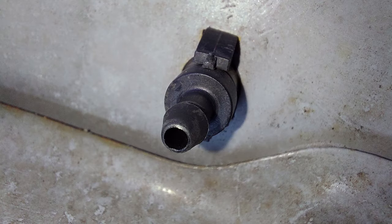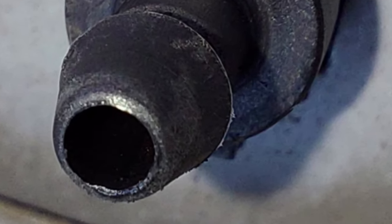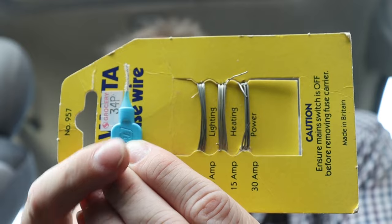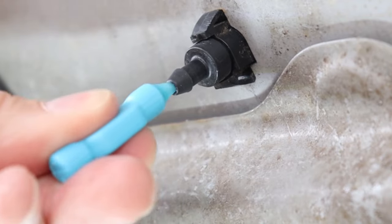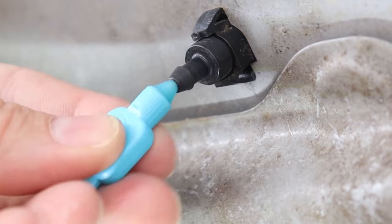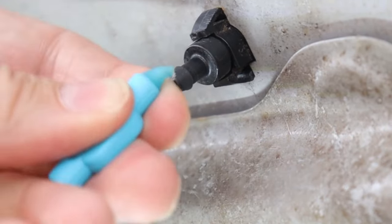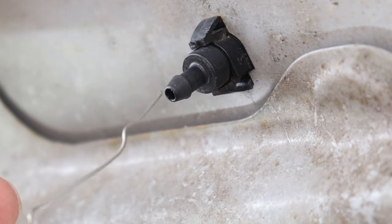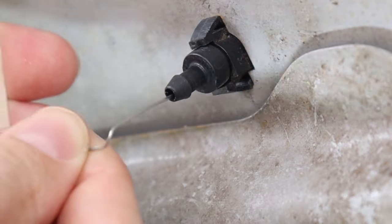We can now see the water inlet hole at the bottom of the washer jet and we need to shove something up there, move it around a bit and try to dislodge some debris. What you use is entirely up to you — that's why I've got fuse wire and the little blue dental stick. Somebody once suggested a guitar string, which could work too. Just find something thin, strong and flexible and have a go. Let's start with the dental brush — pop it in, give it a good go. Then we'll also pop in the wire which is longer and goes in deeper and agitate it around to remove as much debris as possible.